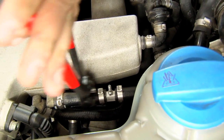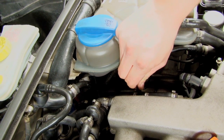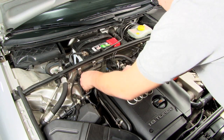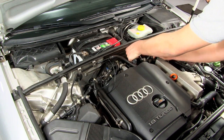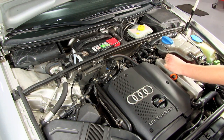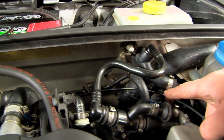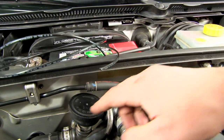To run the vacuum line into the car, begin by cutting a small piece of braided vacuum line and positioning it over the nipple. We're going to run the plastic vacuum line that came with your kit the rest of the way into the car. Begin by running the plastic piece into the OEM grommet and once the desired length is left over, run it against the back of the engine compartment and insert the plastic vacuum line about an inch into the braided piece sitting on the nipple. We chose to secure the plastic line using zip ties along the back wall. So far we've tapped into the intake manifold hose, ran the line along the back wall secured with zip ties, and continued to run it into the OEM grommet.